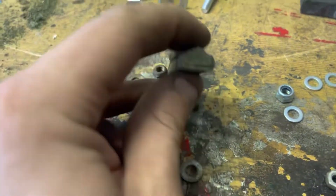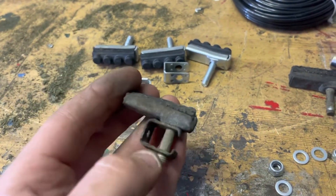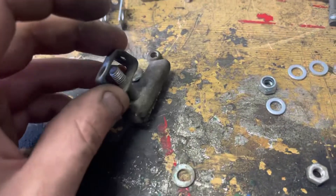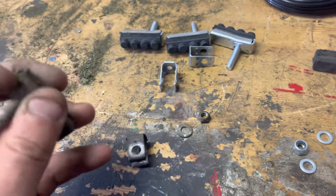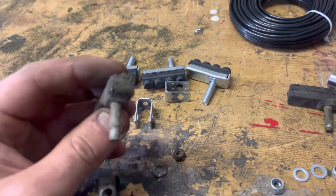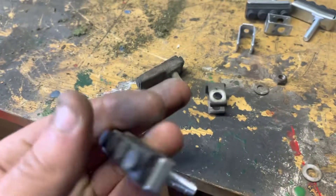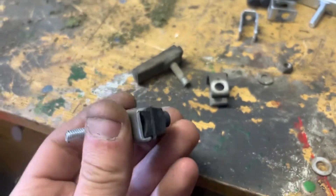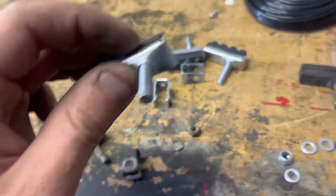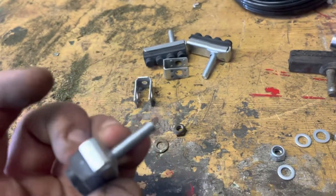There you can see that one. I know you can buy the rubbers to go here, but I was missing two, so that's why I've got all new ones. There is a certain way you put these on as well - you do it according to the rotation of the wheel. The idea is, if you brake hard the rubber can't come out that end but it can go in. You have it so the way the wheel goes, the wheel's forcing it that way. That makes sense.